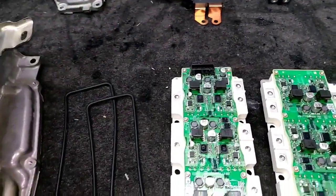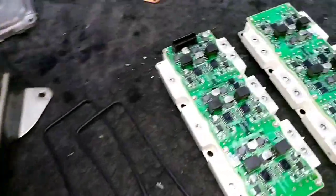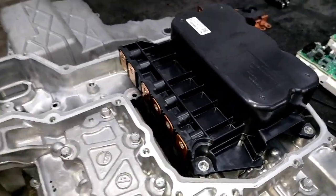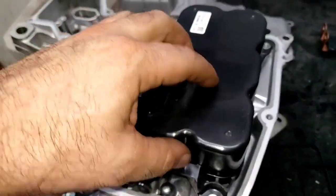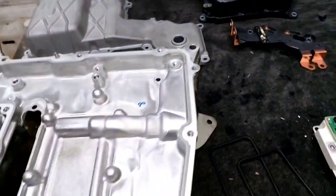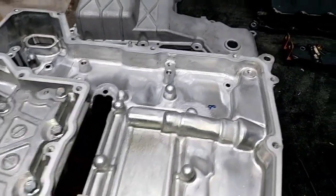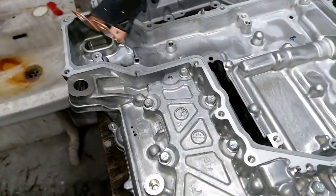Underneath the body, turning this around, we find the capacitor. The capacitor is the one that stores and accumulates power to deliver it to the electric motors — it's a sort of power battery. I was looking to see if this vehicle uses a reactor, but it doesn't. That means this vehicle works with its own voltage, which is why the electric motors are that large and the battery is 330 volts — massive power.